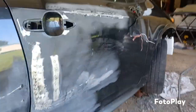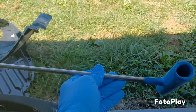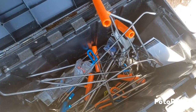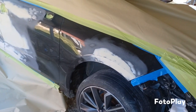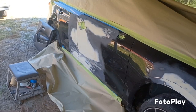Now I'm going in here and getting some mud going — I've been using these dent wizard tools. Dad's got a whole box of them — a gentleman gave them to him — and there's all kinds of stuff in there to do dents with. I got the trim piece in the bumper; it's a little off color but I got it in. Now I'm ready to put primer on this — it's a quickie, just trying to make it look prettier and usable. If I didn't care what it looks like, I wouldn't be Bondoing it.